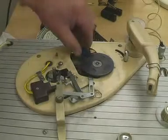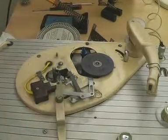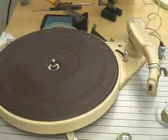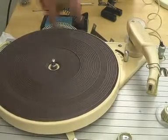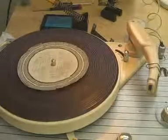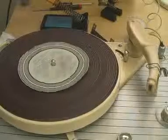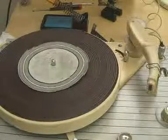We're up and running again. There's plenty of torque in the motor — if we engage the idler, the idler rotates without any noise. With the turntable back on and a little clip to hold it down, it's running at 78. It's rather noisy and looks a little bit reluctant to run up to speed. I have a stroboscope here and a light — it's well up near 78, but there's not a lot of torque. The reason for that is the idler wheel rim has hardened and deteriorated.